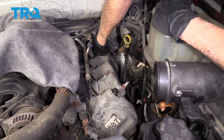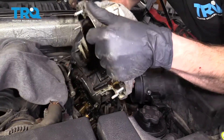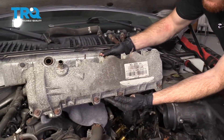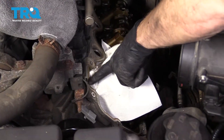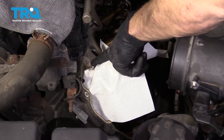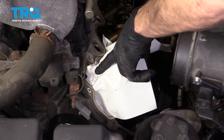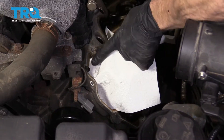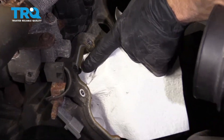After you've done that, we'll just lift it up and get it out of here. There it is, friends. With the valve cover off, it's a good idea to make sure you get off any debris that's remaining around this area. I'm going to typically do this with a vacuum cleaner to get off the majority of it, and then continue on by scraping it with a nice razor blade. Pay attention to the front area of where the valve cover used to ride.